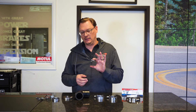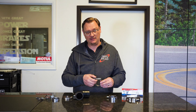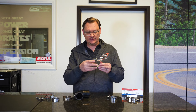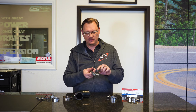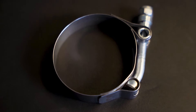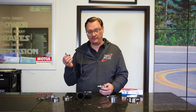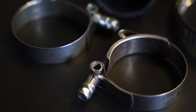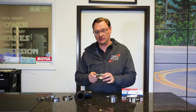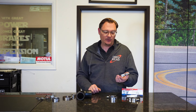If you're dealing with something like an intercooler hose or a radiator hose that's under pressure, over time you can actually have leaks created by the hose clamps digging into your hose material. That's where T-bar clamps come in. A T-bar clamp uses a bolt and a nut to squeeze the clamp, and they'll almost always have a metal inner ring to help slide over the hose and prevent the band of the clamp from digging into it. T-bar clamps are a common upgrade from worm drive clamps, and they let you get a little more torque to really seal that hose onto a surface. They're a bit more expensive, and for something like an intercooler kit running higher boost pressures, this is often the standard clamp that comes with it.